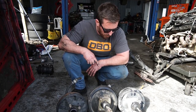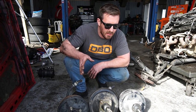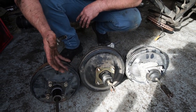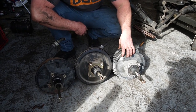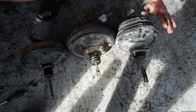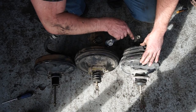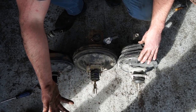I just got done pulling an E34 booster, and I've got some information for those of you doing swaps. A lot of the information on the internet is growing stagnant — it's all leftover crap from the early 2000s. What we've got here is an E21 booster, an E30 318 booster which should be more or less the same dimensionally, and the E34 booster. The E34 booster is thicker — it's a double diaphragm booster, so you're actually going to get more boost power and an easier brake feel out of an E34 or E32 booster.